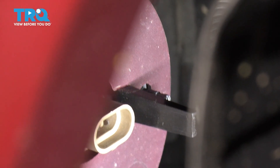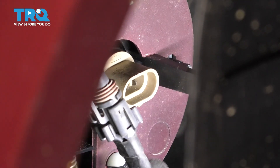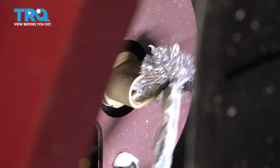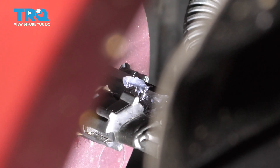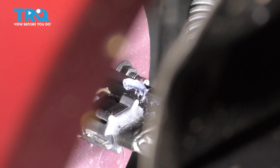Now let's plug it in. Right on the other side of that plastic tab is where you'll see the stud where we're going to put on the mounting nut. Your wire should be close by because it's been hanging for a while. Check for corrosion on the terminals. Before I connect it, I'm going to put some silicone paste — also known as dielectric grease — on the connector on the bulb. Slide this into the bulb until it clicks. Now let's put in the mounting nut, which is supplied with your kit — this happens to be an 8mm nut. Snug it up, but don't make it too tight; it's a very small nut and it can break or strip out the threads. Now let's do the same to the other side and then we'll put the switch in.